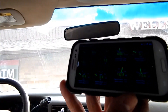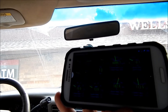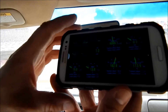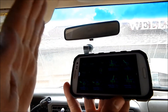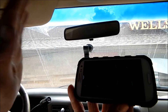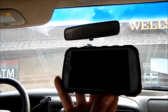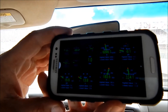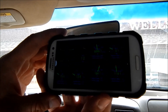The gauges I'm actually watching are: IPR, injection pulse width, H-pop, run time, exhaust back pressure, battery voltage, which gear I'm in, TC slip (which is torque converter slip) — this will move around, but when the torque converter locks up it should be locked and not moving; if you see it moving, your torque converter is slipping. Then elevation — I live in the mountains at about 6,200 feet — oil temperature, transmission temperature, and boost.